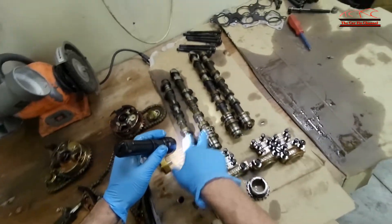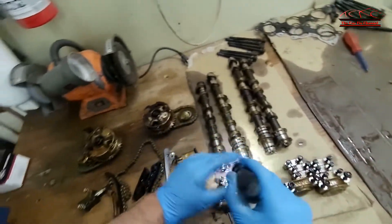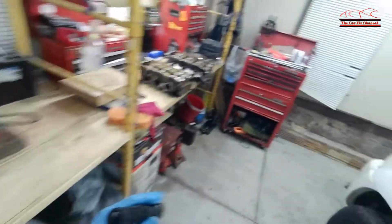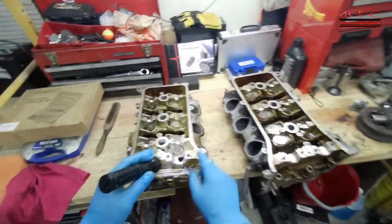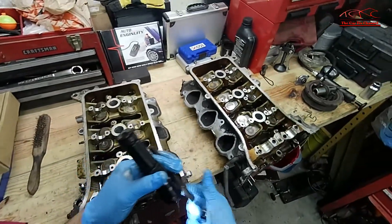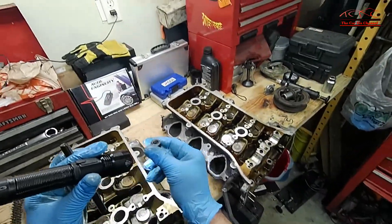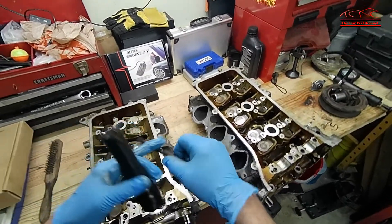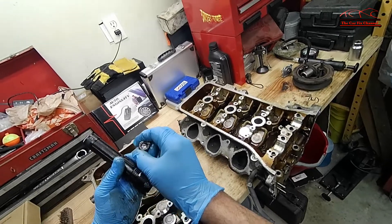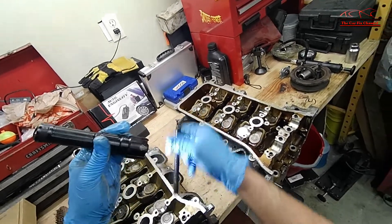This is the right side and this is the left side — along with the actuators and timing chain. I also had an issue with one of the cylinder head bolts on the right side right here — the head of the bolt stripped out. So I had to drill the head of the bolt to get the cylinder head out.